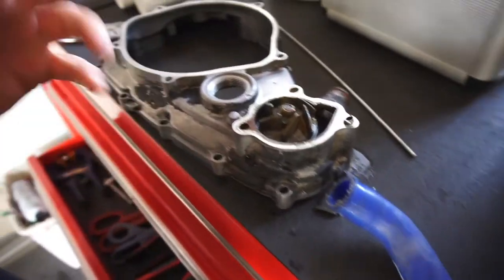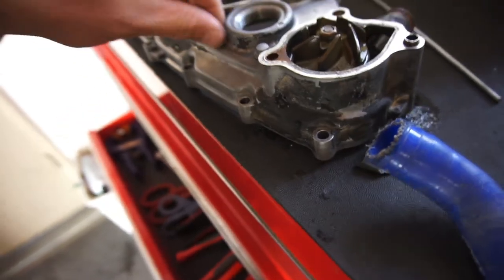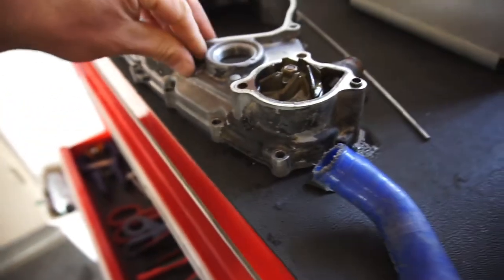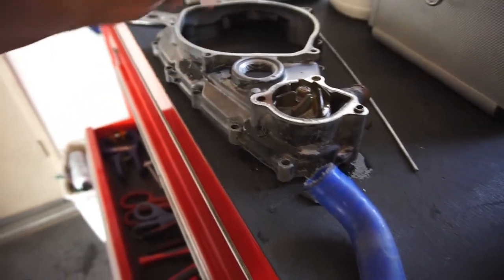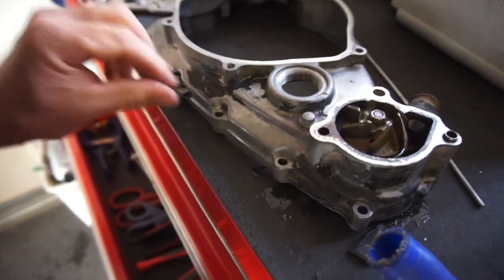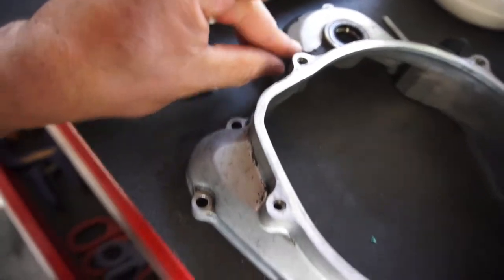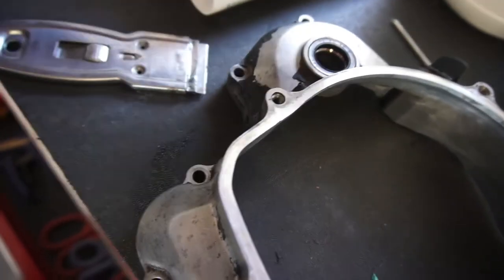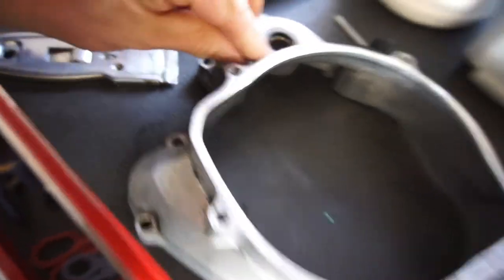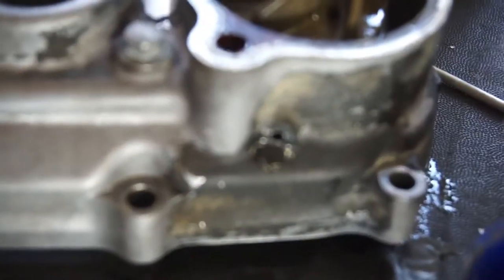Basically I need a whole kit. I shouldn't just order the gasket because I can order the whole kit with the gasket included. What I also want to do - I think they Plasti-Dip these cases from Honda. I'm not 100% sure, but I want to say they do because I've seen a lot of bikes with them being black. Since I can't get all of it off without spending forever on it, I'll just re-Plasti-Dip this case. You can see more stuff coming out of that weep hole.